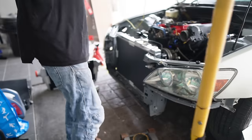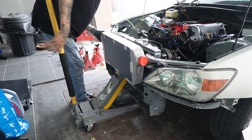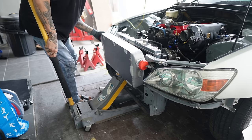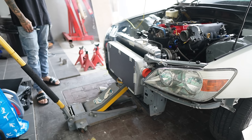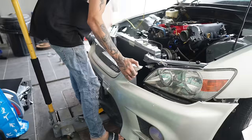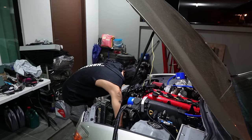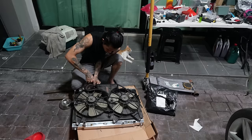The next day is going to be a very important part of the car — the intercooler! I just got this and I'm ready to test fit it. Initially I wanted to mount it upside down because I wanted a straight direction to the throttle body. But I realised it was too close to the radiator and it would defeat the purpose of cooling the air, so I went back to the conventional way of installing an intercooler. Then I sat down and planned how I'm going to do this — I just need to settle the issue of my radiator clearance.